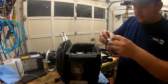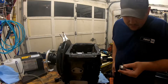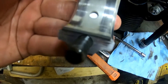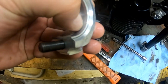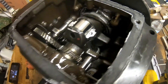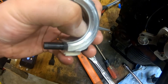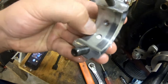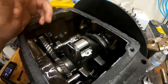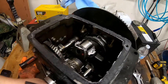Okay, let's see what she looks like. Not as bad as I was thinking — it's got a little wiping going on on the edge but it is not grooved. I ran my finger across it here and it's not grooved at all. The crank actually still looks really good — there are no grooves in it. This is not a pressure-lubed motor so this is probably to be expected. There was no copper showing at all in this bearing, so I would say I could have probably run this again for next season, but I'll go ahead and throw a new set in.